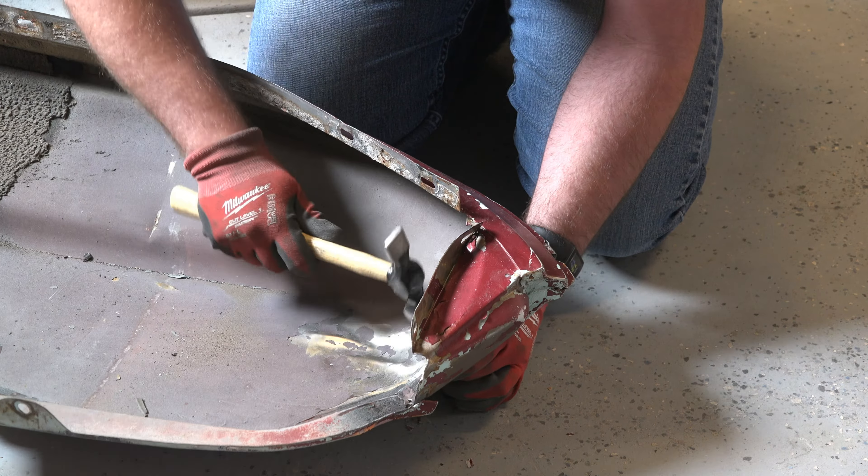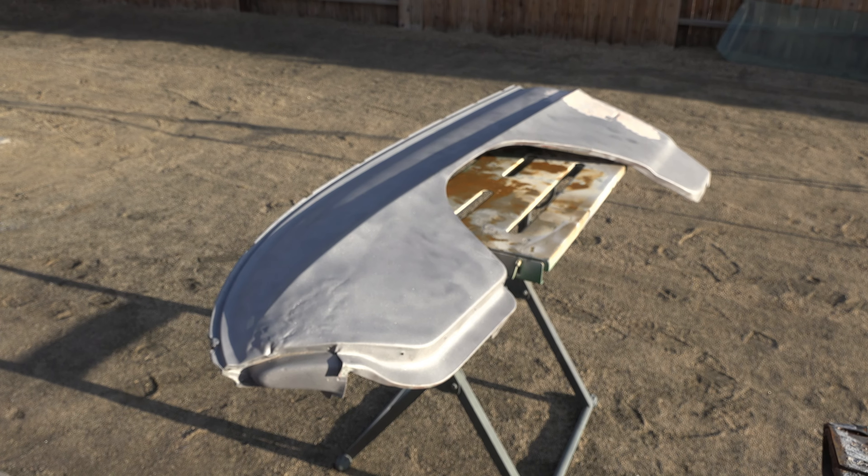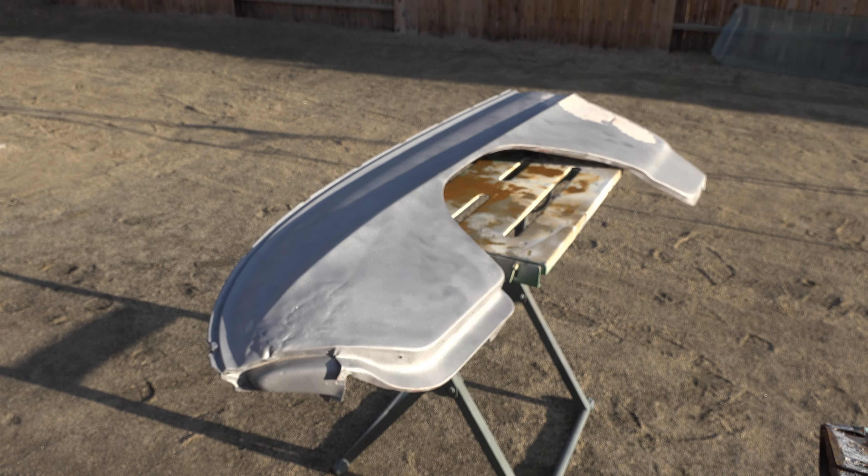The next day, my dad decided to help me and sandblast the fenders while I was working on some homework. At the end of the sandblasting, I could see what I was truly dealing with. The front of the fender was looking better but still needed a ton of work. The rear of the fender was what caught me off guard — there was a ton of Bondo on the rear, and it got quite deep in some places. This damage wasn't obvious at first because the dent was covered by the subframe on the inside. When I looked between the subframe and the fender, I could see Bondo squeezed out from two holes that were punched straight through the fender.